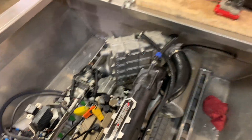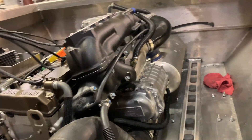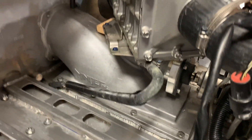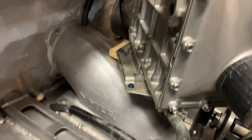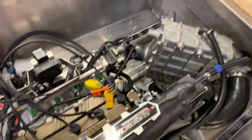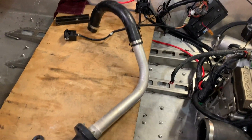This is how the engine is going to lay out — it's in here pretty tight even though there's a ton of space. The only thing I have to figure out is how to get this mount over the mini-jet intake. Once it's in position, I need to build a jig underneath it, build it out of aluminum, and tack it to the boat. Next step is getting the fuel cell in and firing the boat up to make sure everything still works, then I'll start on the mounts, fuel cell, and bulkhead.